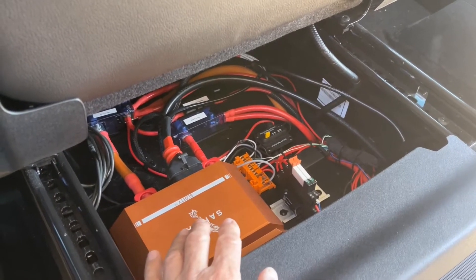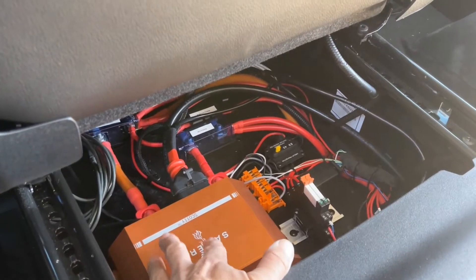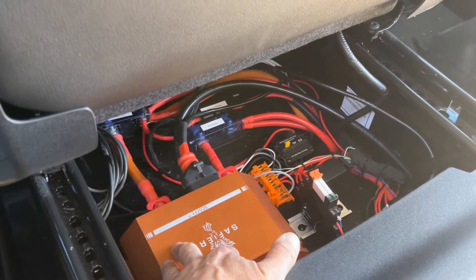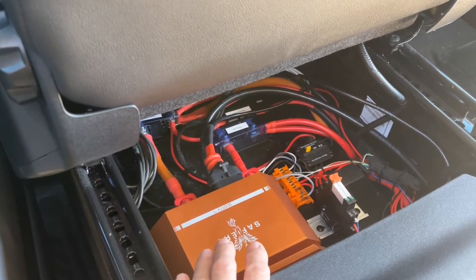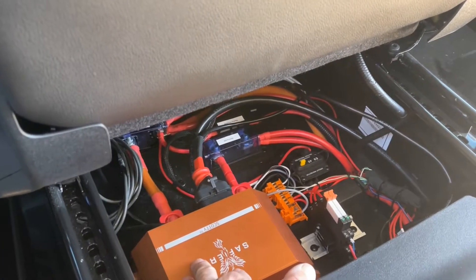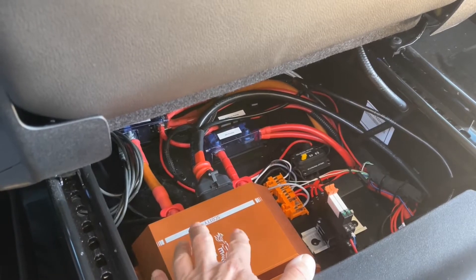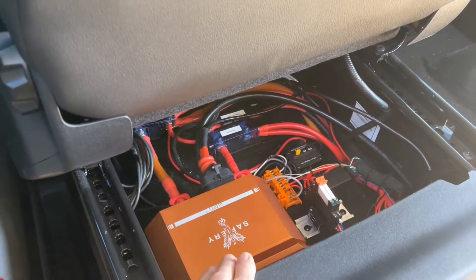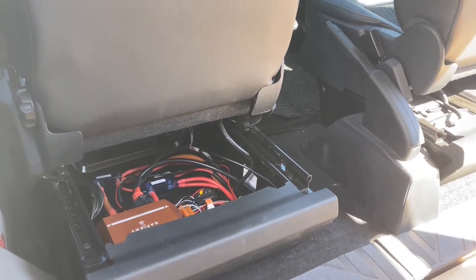Below 1000 RPM there's no load on the alternator at all. Above 1000 RPM this will come on and go up to 2500 watts. So when you're at the lights and you stop, it automatically turns off — no load. Take off over 1000 RPM and it will start up again. We've got a slow startup: I've programmed a 15-second delay after 1000 RPM before it starts up. This suddenly makes this vehicle fully compliant.